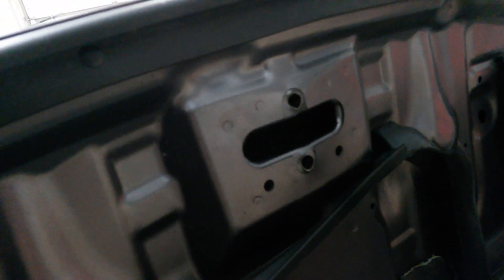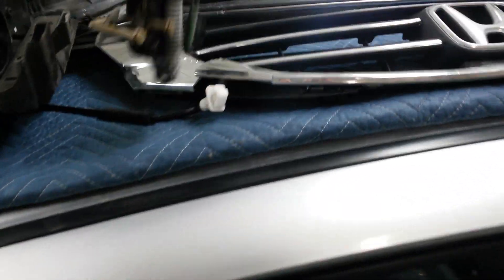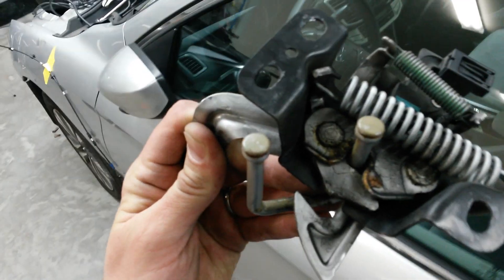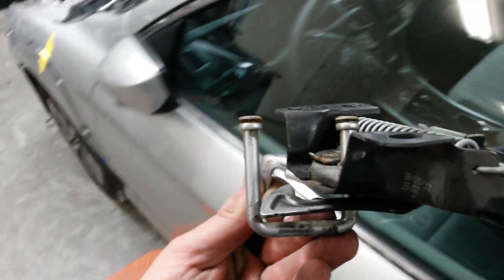Let me get the phone out of the tripod, I can show you better. The striker's actually been ripped out of it — I didn't realize that until I bought it, got it on the trailer, and went back inside and told them about it. So they gave me another $50 off. But other than that it's okay. I'm just going to knock this back in flat. Apparently this is a real weak connection here because the same thing happened to this car that I've got. I'm just going to enlarge the holes in the hood after I flatten it down with a step drill, set the latch in there, clamp or tape it in place, and weld it to the hood. A full weld around each pin there will be plenty sufficient.